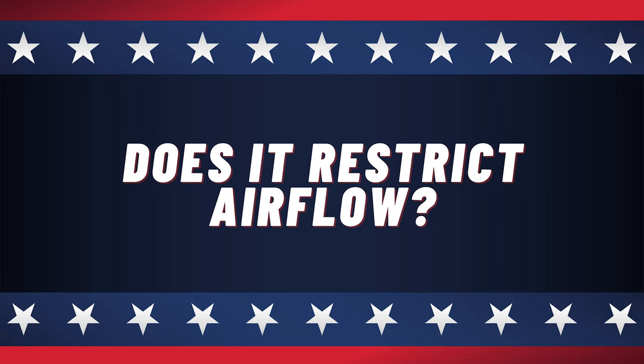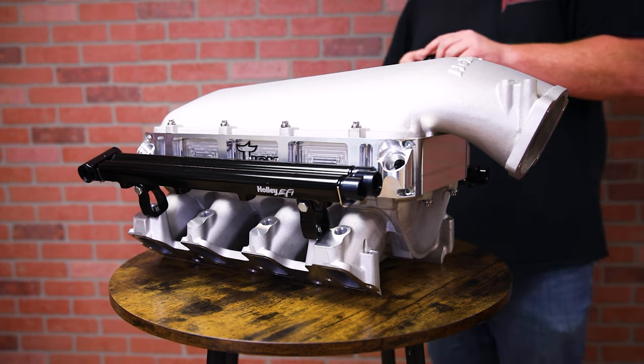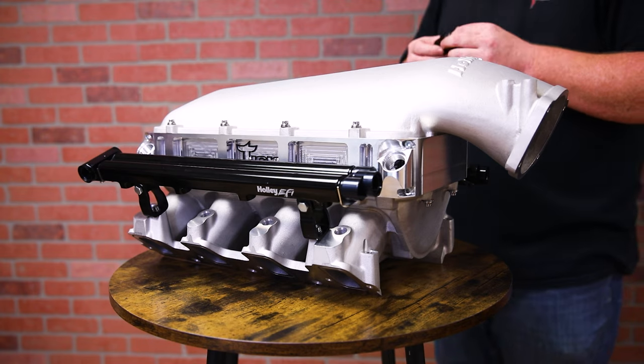What kind of air restriction is incorporated with an air-water intercooler? With any intercooler, you have a nest of fins inside and you're blowing air across those fins, so there's naturally going to be some pressure drop depending on how much pressure you're pushing through it. To give a flat percentage isn't really possible, but some customers have seen under a pound of boost drop on a 900 horsepower application, while others have seen one to one-and-a-half pound drops on 1,200 to 1,300 horsepower applications.